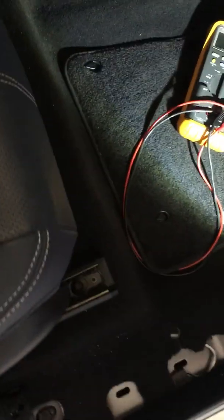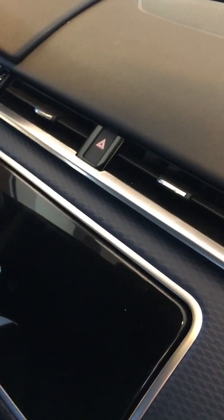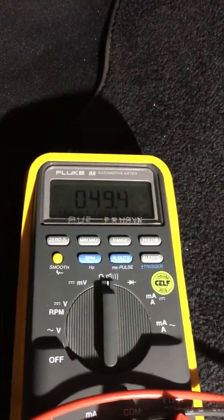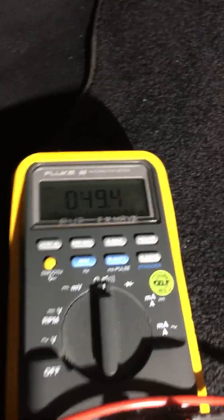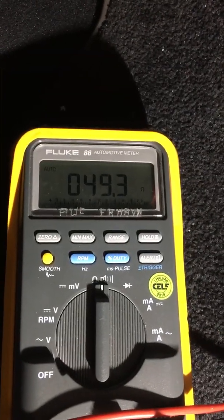Short video testing FlexRay. Cars-off resistance between the two pins on the FlexRay network is 50 ohms when everything is off. I measured it at the connector on the transmission — connected between the body control module and transmission control module — and we see 50 ohms when everything is intact.